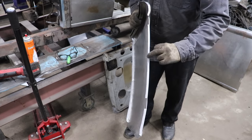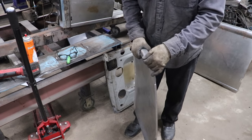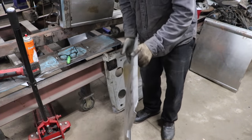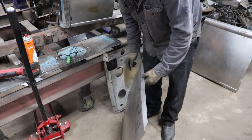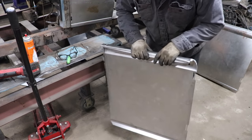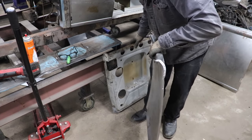It's not perfect - the trim comes in, kind of goes in and then comes back out. Now I don't really care because that's folding over on the inside, but don't expect these skins to be like something Ford would have made. The bottom edge here, they roll the bead and they kind of start the bend but they don't really fully break the edge on it, so it's just kind of at a 45, so we've got to roll that over. I'm hoping I can just start test fitting stuff, though I'm afraid this bottom edge might become a problem.